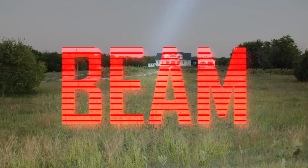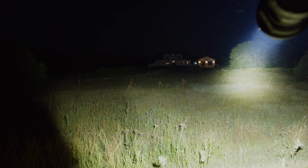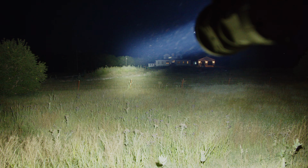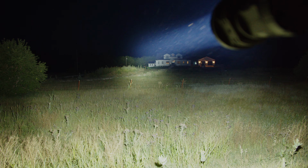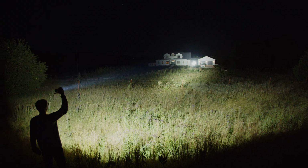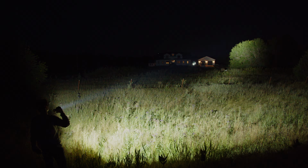In addition to being super bright, the Luminus SFT40s produce a tight, punchy hotspot and a wide, bright spill that simultaneously reaches far into the darkness while lighting up a large area. It is an excellent beam for a high-power, serious use light, which in my opinion makes this the best option for the MK38. Sadly, this beam isn't very pretty, being very cool white, low CRI, and somewhat greenish.